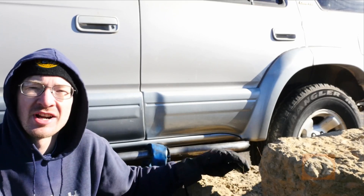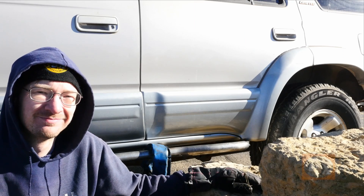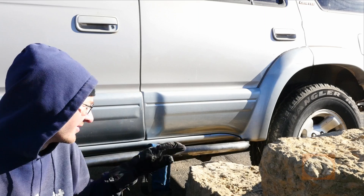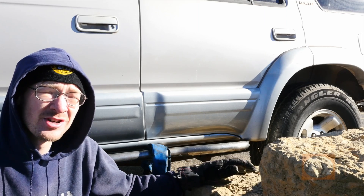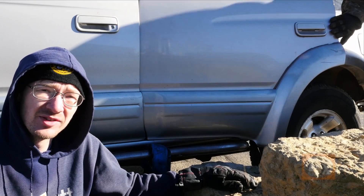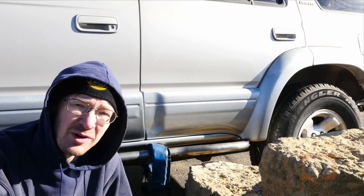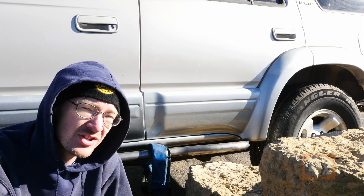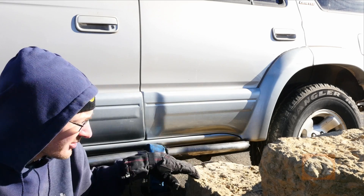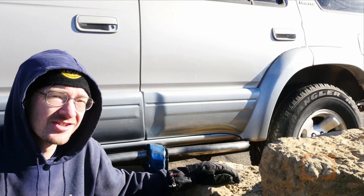We just did the 18-inch drop on the DOM slider on the kickout itself. Honestly, it's actually less bent than when we dropped it further up on the slider — you can't even tell that it bent at all. The door still opens just fine. It doesn't even touch the fender flare on the limited flares. There is no denting whatsoever on the bottom of the tube, which is also really interesting because the way the tube is shaped, we actually point loaded on two spots — it wasn't flat across like the main piece. Really impressive results on that.